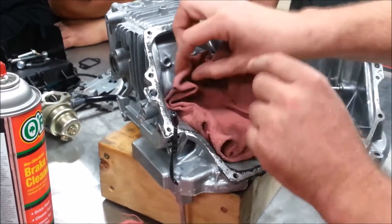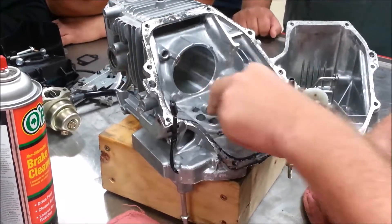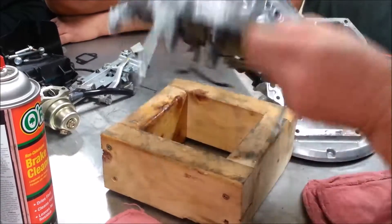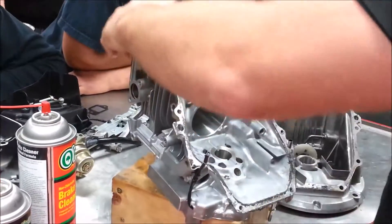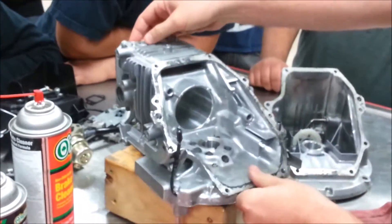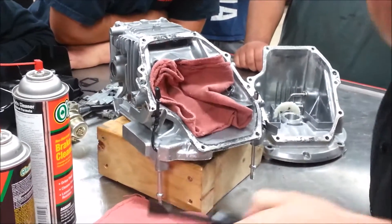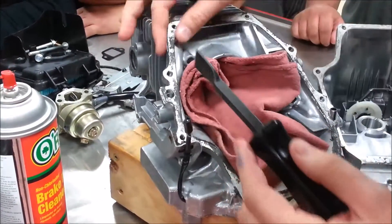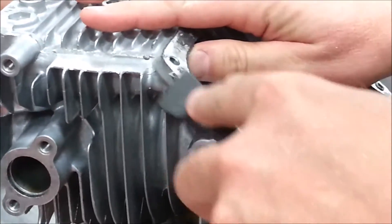This engine is very simple in design, but when you get to bigger engines you might have little oil passages — do I want to get stuff in there that would block an oil passage? I don't want to stick gasket material through a hole that would get inside the lip of a seal and cause a problem. So protecting our work area is important. You notice how I grab that wire every time — just a good habit. Most people want to scrape forward, but watch — I'm going to go along the edge very lightly this way, and usually that'll make it pull right off.